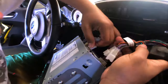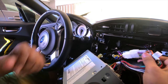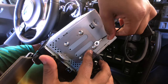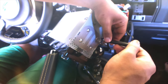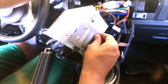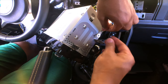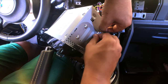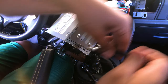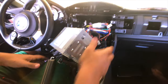To make disconnecting easier, use a trim popper clip tool — it makes removing harness connections really easy. Also, don't forget to unplug your battery when doing this or all hell could break loose. As for the grounding cable, the instructions say to unscrew the lower rear bolt on the passenger side of your radio. It's very tight, so be careful — make sure you get the right sized Phillips or you can end up stripping your screw. Apply the negative connector, screw it back in by hand, tighten it, and you're all done with your radio connection — ready to be popped back in.